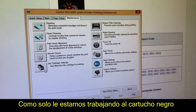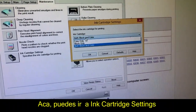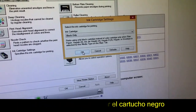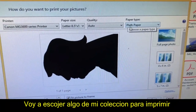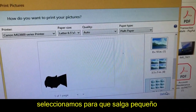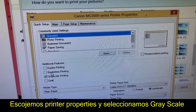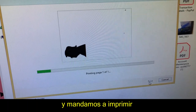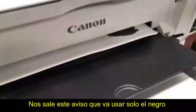Since we're only working on the black cartridge, let me show a trick. You can go to cartridge settings and let it only use the black cartridge or the color cartridge. Now make sure we select three things: one is we use plain paper, not glossy. Then go to Options, then Printer Properties, and make sure we turn grayscale on and borderless printing off. Now if I click print — booyah! Black cartridge. That's the cartridge that hardworking Americans use.